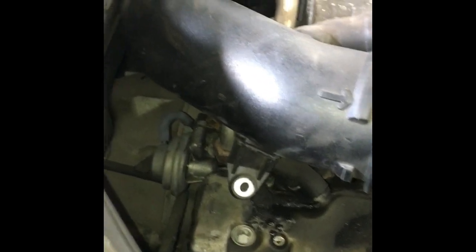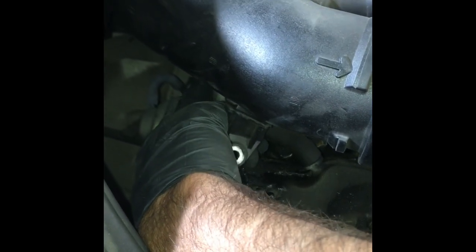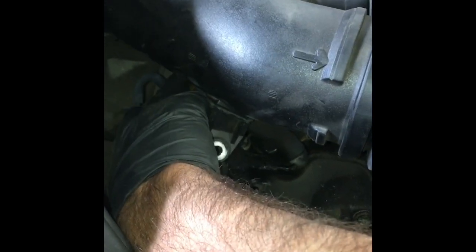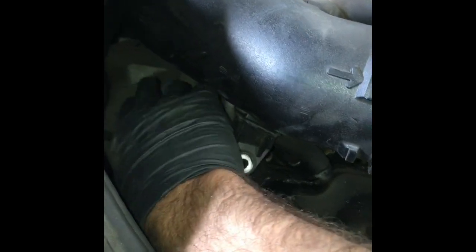So what I'm going to do next is fix the vacuum line and put my gauge on this side of the EGR valve, apply power and ground to the switch to make sure I get a signal and confirm that the electrical connector works. After that, I'll plug it back in and apply power and ground again to see if it makes the engine stall, stumble, or hesitate.